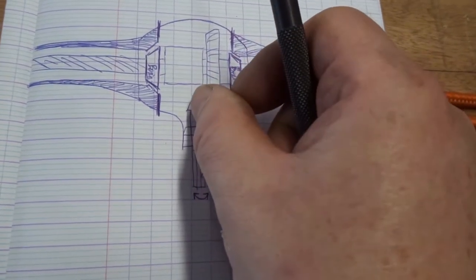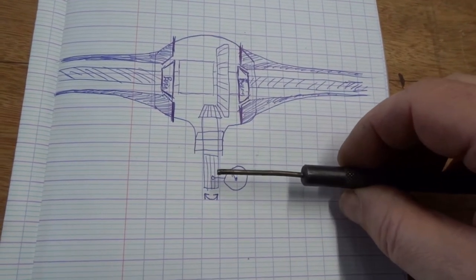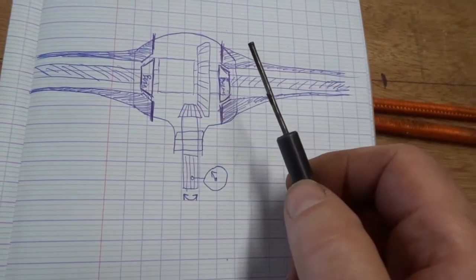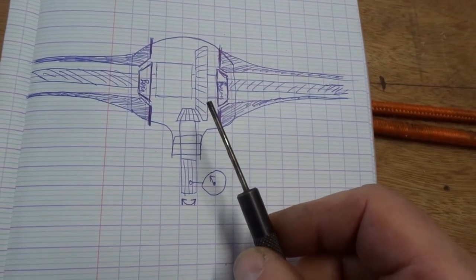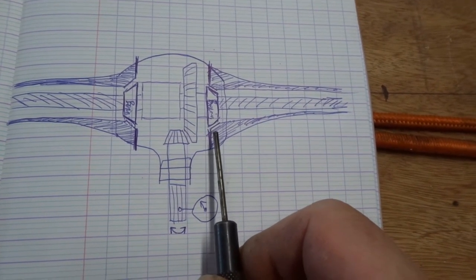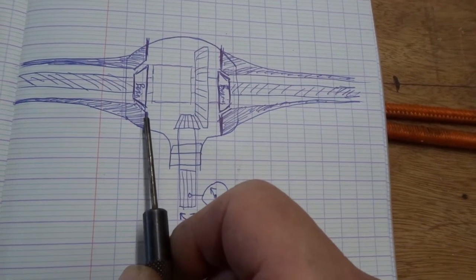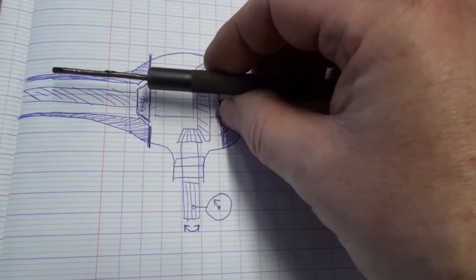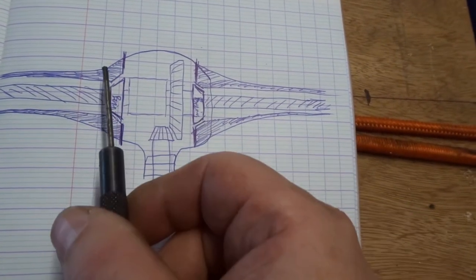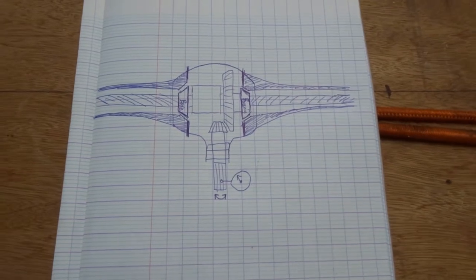Because later on you're going to be looking at the free play between the pinion gear and the crown wheel. That's measured by fitting the pinion assembly, rotating it back and forth and using a dial gauge. There shouldn't be more than a certain amount of play - there should be a tiny bit of free play but not much and they certainly shouldn't be binding. If they're binding you put a thicker gasket on one side and a thinner one by the same amount on the other side, which moves the whole assembly just a tad but keeps the distance between bearing races the same.